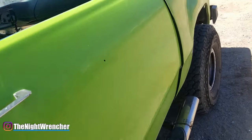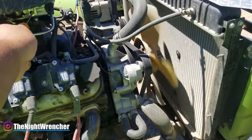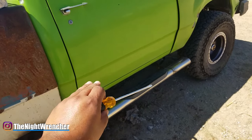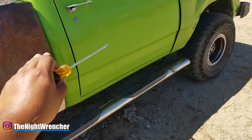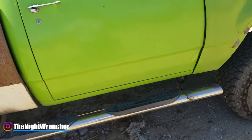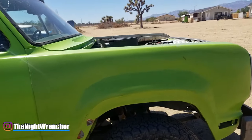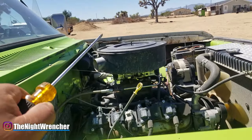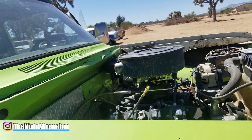As an engine gets leaner, it's going to start popping out through the exhaust. It's not that noticeable right now, so let's go ahead and turn it another quarter of an inch to really exaggerate the situation. You're going to start hearing intermittent popping — it'll just be idling and it'll go pop, pop, pop, like just random popping out through the exhaust. That definitely tells you that it's a lean condition. If you are trying to accelerate and it pops through the intake, then you have a lean condition, or you don't have enough timing. But typically, if you already have your timing all set up, the rest is going to be pretty straightforward.